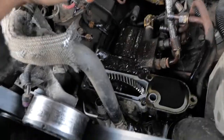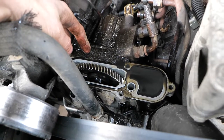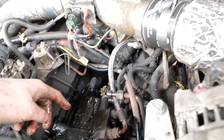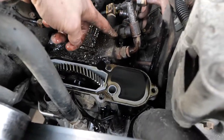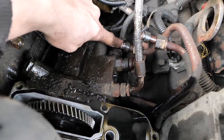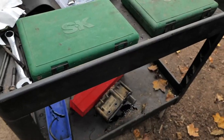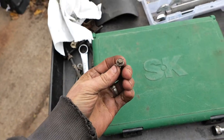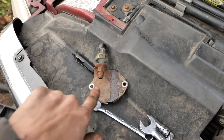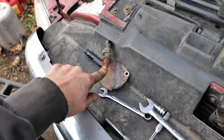That's the gear that drives it. It's not timed because it's a HEUI system, so it just exercises valve operations to put oil pressure behind the diesel fuel. These lines go to the high-pressure pump, and there's a sensor wire right there — you've got to be careful with that, but it has a wire clip thing that flips over. You're taking out two 8-millimeter bolts to go into the holes on this plate right there. But before you do that, you have to unscrew something from this very rusty exhaust fitting.